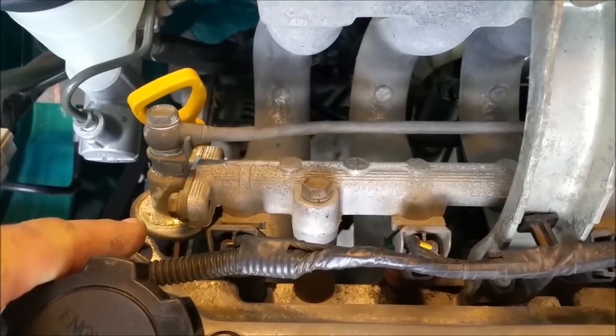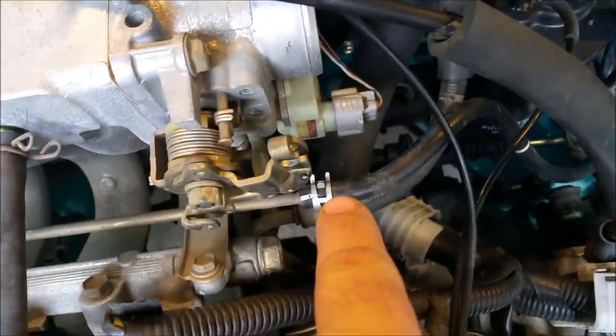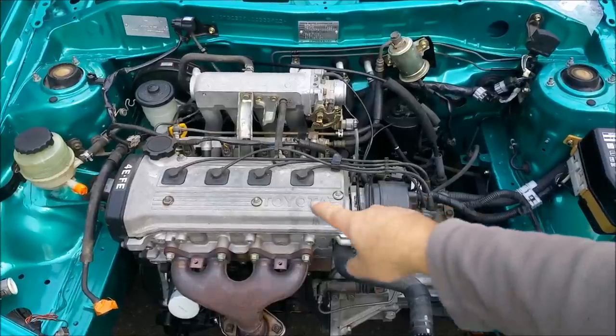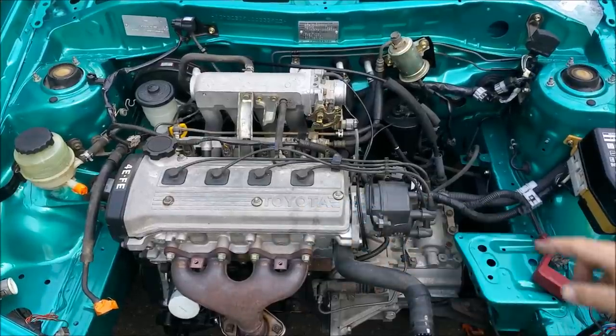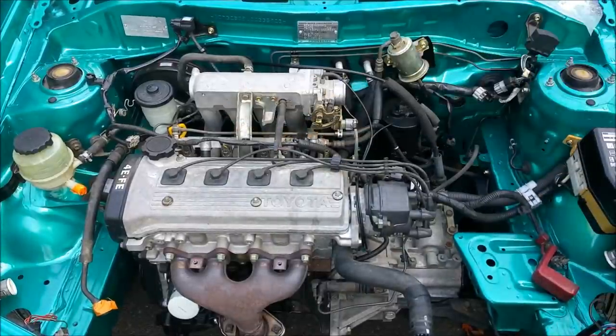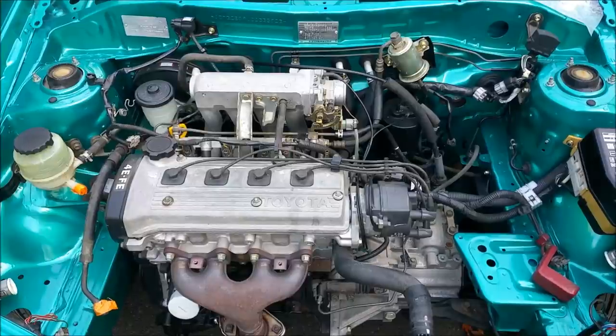So anything over and above that pressure is bled off and sent down that pipe back to the fuel tank. Right, so this vehicle is electronically fuel injected and it uses a computer to determine when the spark fires through these plugs here and when the fuel is injected through the fuel injectors here. They're the two outputs the computer puts out, but in order for it to supply an output, it needs to know a lot of information about what the engine's doing by way of its inputs.